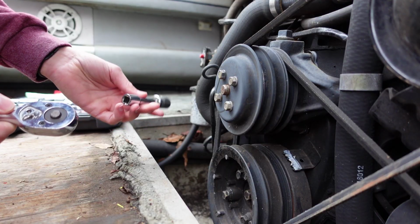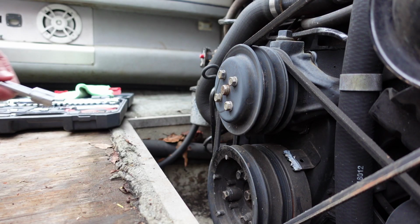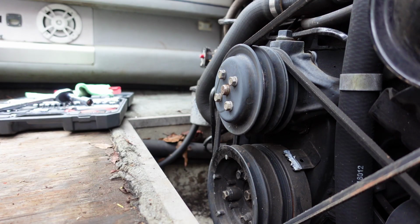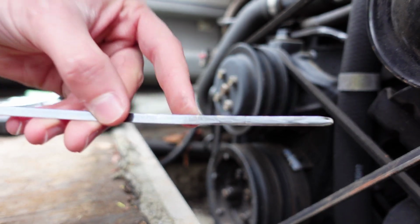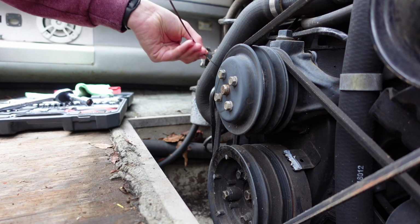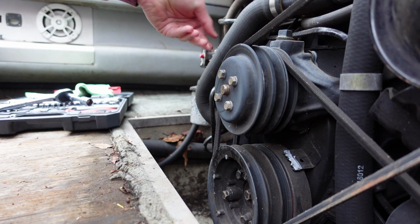Alright, first thing we're gonna check is see if this thing is locked up or not. The gentleman said it won't turn with the starter. Maybe we should pull the oil stick first. Okay, well, it's overfull. It's right up to the full mark right there, and very black. Smells like 10W-30. At least it's got oil.